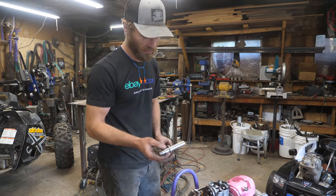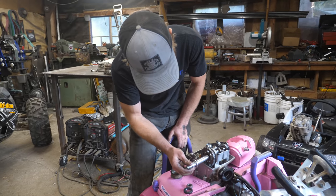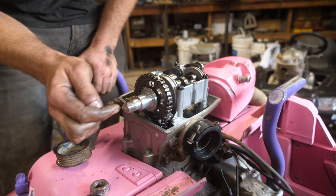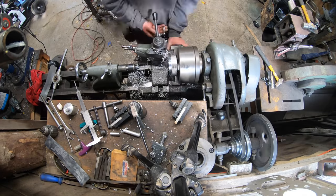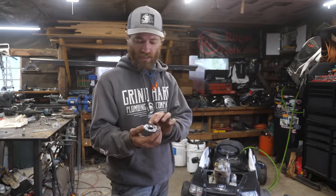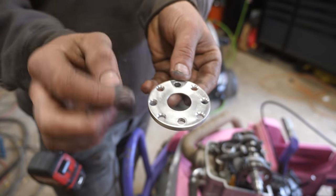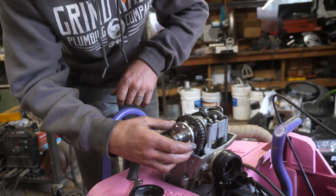Here's the supercharger pulley drive shaft. I made it on the lathe out of a solid chunk of aluminum — easier to work with, lighter weight, and plenty strong. I wasn't able to test fit it while it was in the lathe, but using calipers I got it so snug it's airtight. You can see the springiness of the air in there. After a bit more lathe work and drilling, I've got my clamp plate complete with speed holes.